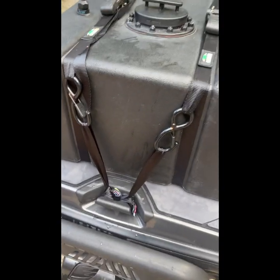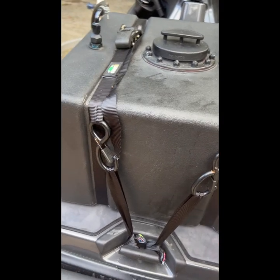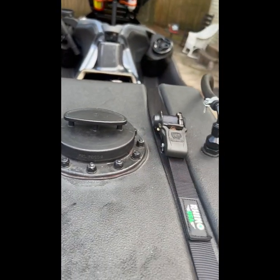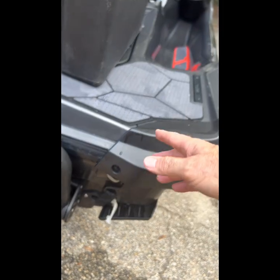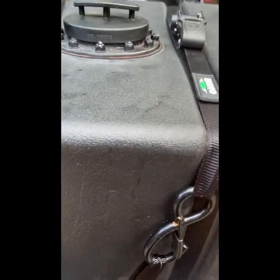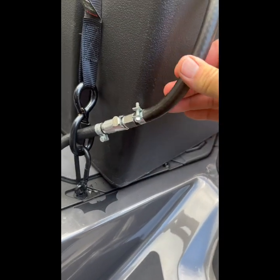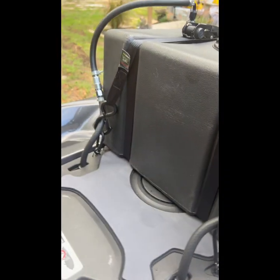I'm going to give you a look at my gas tank. This is a 16-gallon round track tank — a lot cheaper than marine tanks, and I wanted it smaller. When you put your straps on, even though I'm coming from the inside right now, I came around and came back through on the inside part to come with that strap. You always want to make sure that strap at the end is coming on the inside, because you can hook this eye right here with a bigger tank. The fuel lines — I usually run them through the snap so that they don't have to bounce around or beat around too much. And that's pretty much the setup I have.